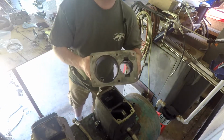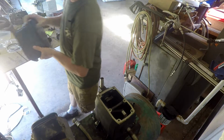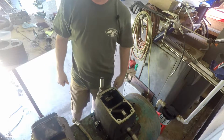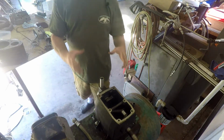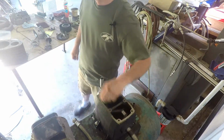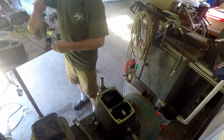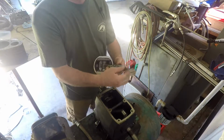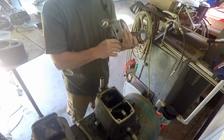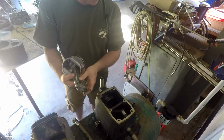So the best way you can do this is get your pistons sitting in here in the crankshaft and torque them down. Get your gasket down and we'll try to slide the sleeve over all that, and of course get it all lubed up with some kind of oil real good, and hope we can get all this done. I've talked too much instead of working, don't I? I don't have any air to blow anything clean. This is pretty clean. We're gonna have to go with it. I don't have time to monkey around.